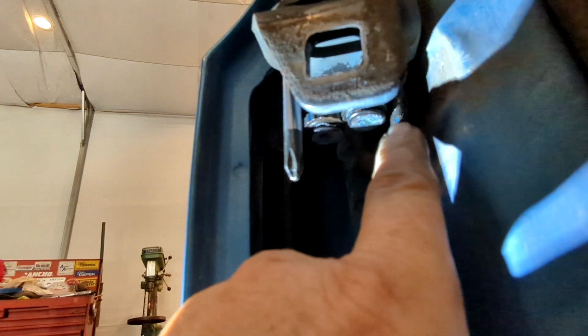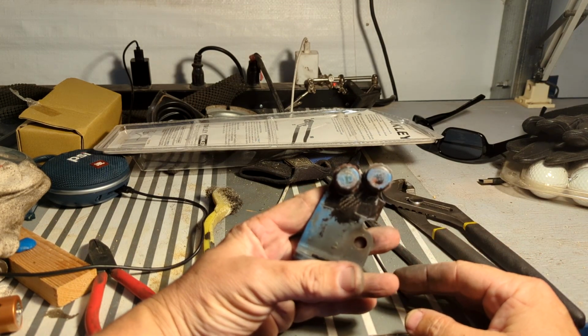All right, here's what's supposed to be happening. You've got that spring, this S-spring in here, rod. And these wheels are supposed to rotate as you open and close the door against that. That has its spring, it gives to some degree, but the point is that these rollers are supposed to roll as you go across it. And then it holds in a position here, halfway open, and then fully open. So these haven't been rolling for some time.